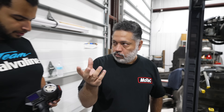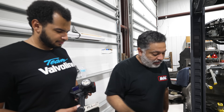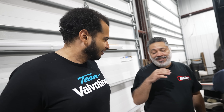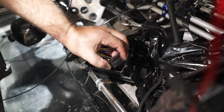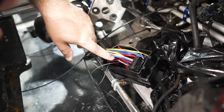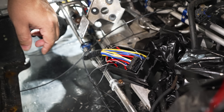So the RC controller comes with a receiver — it comes in a kit for your remote control truck. When I put this harness together, I did not want you to find out, so I actually hid the receiver in this relay box that is used for the starter and fuel pump. If you look right here — I took the cover off — in the relay box I hid the receiver, and this is it. It's just a little guy. There are three wires coming out of it: black, red, and white. Red is five volts coming from the ECU to power it, black is obviously ground, and white — that's the secret sauce.